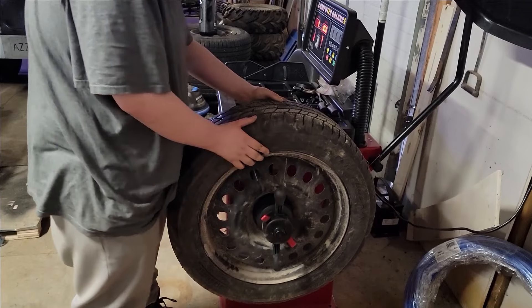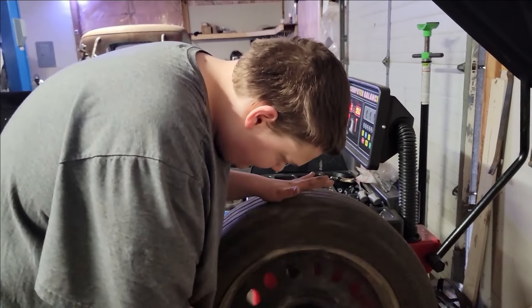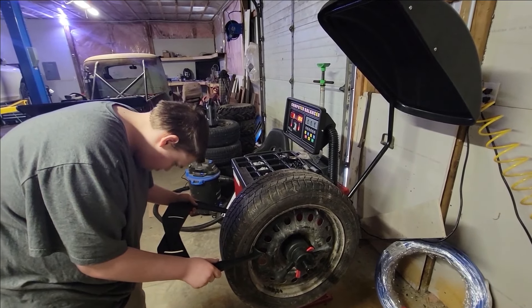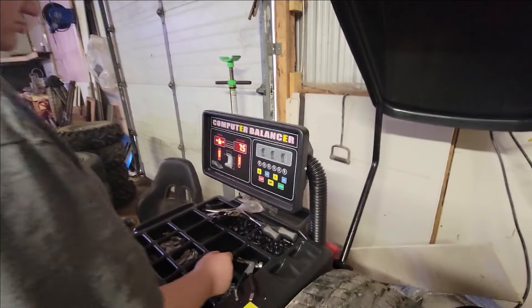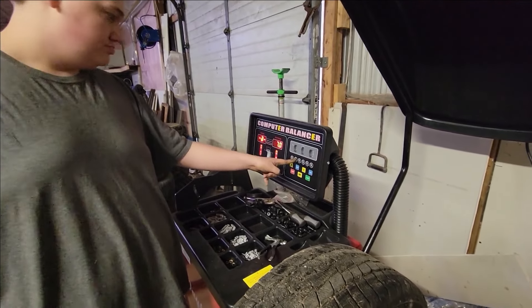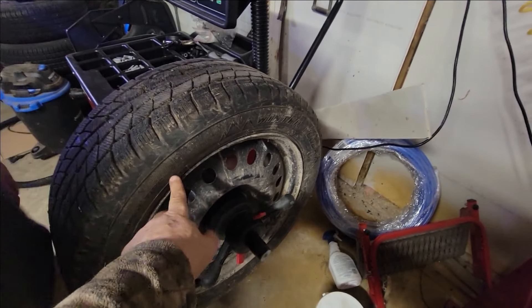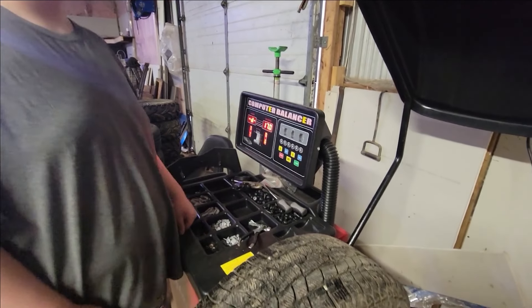You got one of them at school, do you? Yeah. You're not even close to on there straight. We're gonna look at that. Now it says tighten it up — what's it say? 7.5, 7.5 — there you go. What are the other two things you need? You're measuring the offset — that's 5, looks like 5.5, but it's actually 7. Now what's the last thing you've got to do? It's the rim — how big is the rim? 16? You could measure it or just look at the tire. It's a 17. All right, close the lid.